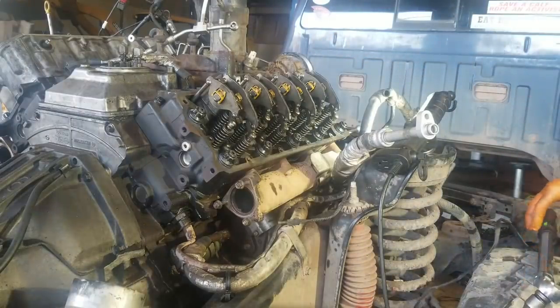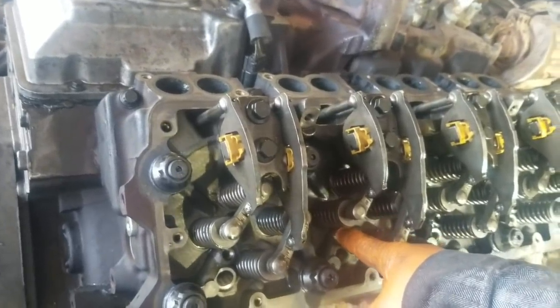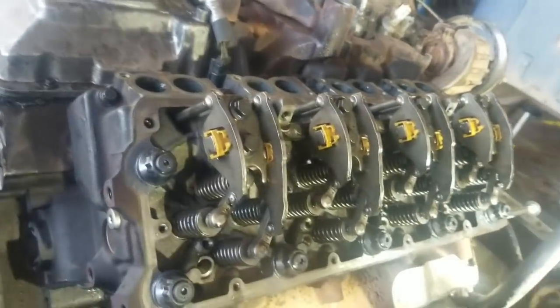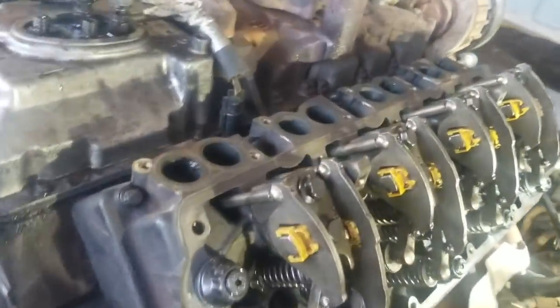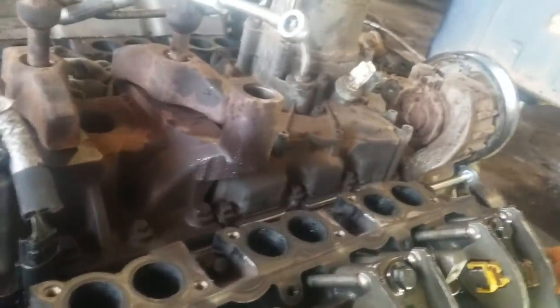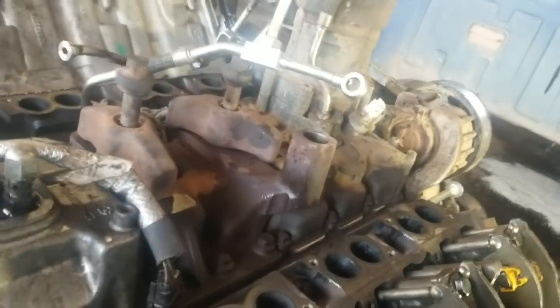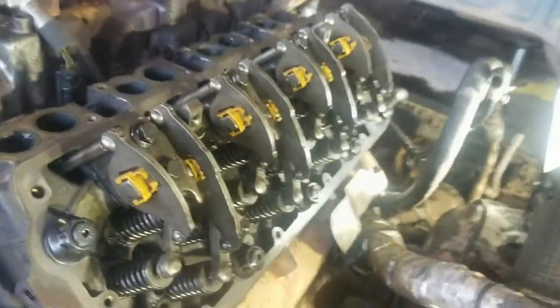Okay, so the next thing you want to do is make sure your holes are cleaned out really good where your injectors go. Put your injectors in, cinch them down to where they're not tight. Leave maybe one or two threads loose on it. You know, go down and then back it out just a little bit. And then we'll put the rocker box on, torque the rocker box down. And then you put your fuel rail on, but first we're going to blow that fuel rail out and clean it out and make sure it's clean before we stick it on there. Just clean some of that ARP assembly lube off the seat and surface for the gasket there.